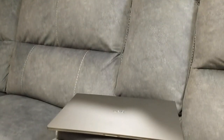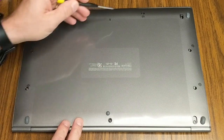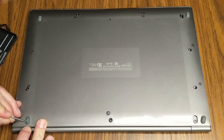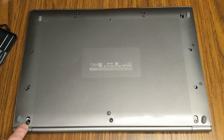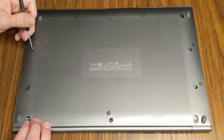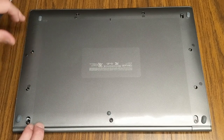Now let's get to the fun part — opening up the computer. We want to remove our cover. The cover is held on by 11 little screws and they hide these screws under little plastic discs and rubber feet. You can use a small flathead screwdriver as well as tweezers to get in between the plastic cover and the rubber feet and start prying up. Once you get those off, stick the rubber feet and plastic discs right next to where they go so you don't lose them. Then use your Phillips screwdriver and unscrew all the screws.